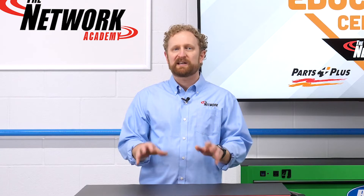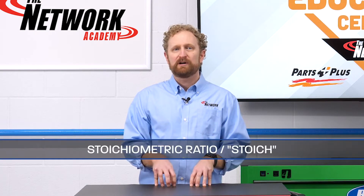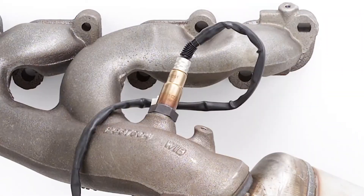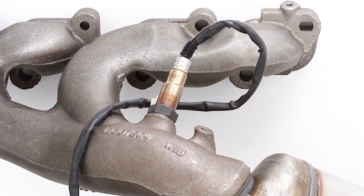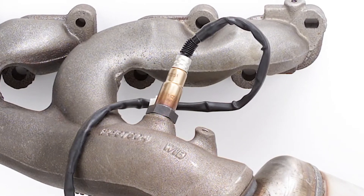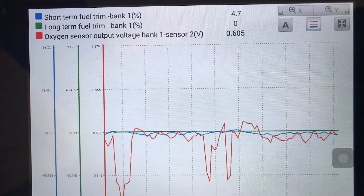When the air-fuel ratio is just right, the engine is burning fuel at maximum efficiency, which some people call the stoichiometric ratio, or even just stoic. Oxygen sensors play a very important role in all this. An O2 sensor measures the difference in oxygen in the outside air and inside the exhaust, and reports the finding to the ECU to calculate the exact amount of fuel.